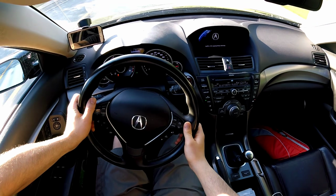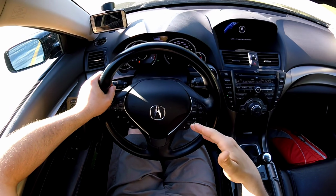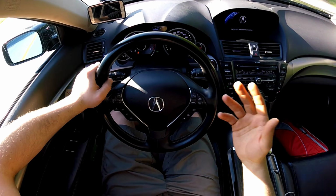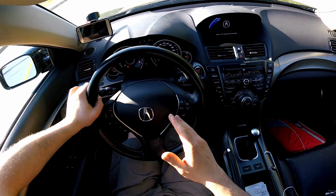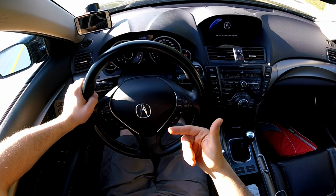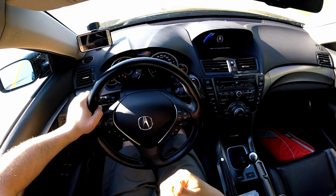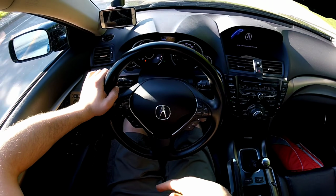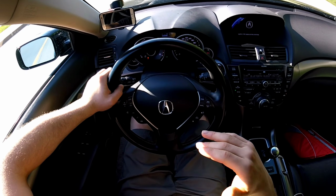I just can't get enough of that sound. Now I can actually have fun and have some sound without having to crank it to 5,000 to 7,000 to hear the VTEC with the intake. My overall goal for exhaust setup is going to be the RV6 pre-cat deletes, the Accelerate J-pipe, and the Accelerate catback exhaust. So that's going to be my setup hopefully by next year, but for now this is just fine.